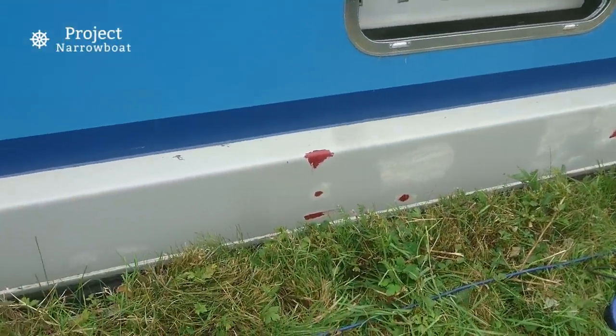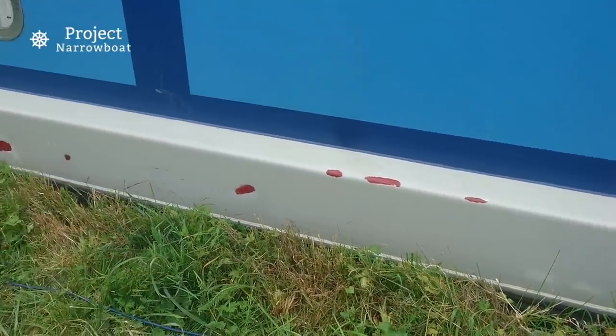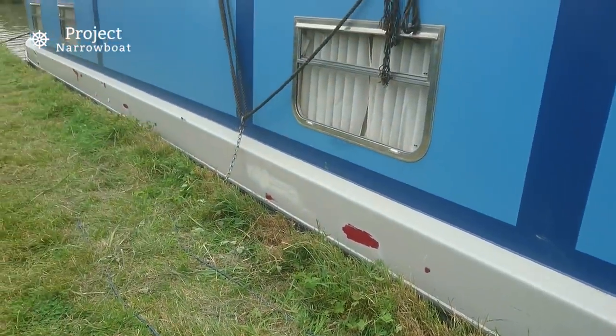So I'm all done for now — that's a couple of coats of red oxide on the bits that had bare metal underneath. The bits where I've put a bit of filler in cosmetically over paint where I hadn't done as well before, I've just left in the filler and that'll be easier to cover with the grey. When I do paint the top coat of grey I need to make sure it's really nice and clean first, because if you paint over dirt you'll trap it under and it'll always look darker or the wrong colour. I should wait for it all to dry, give it a really good clean, then get the light grey out and give it a top coat. As you can see I've picked out quite a few little imperfections — it's funny how these jobs tend to grow once you get started.